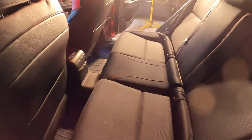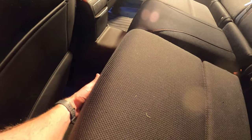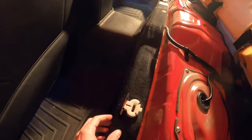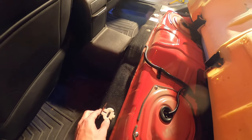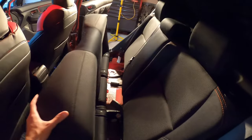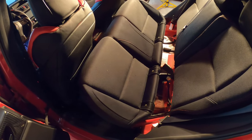Looking at the rear, one thing you have to do is pull some tabs — one on each side — and the seat will pop out. These tabs: you pull towards the front of the vehicle, not up and not down, pull out. Once you have it taken off, set it up on the table and get the new seat covers applied to it.